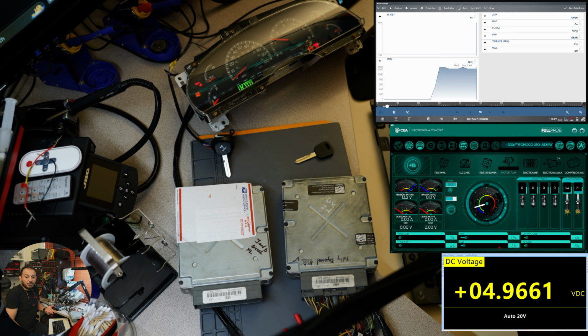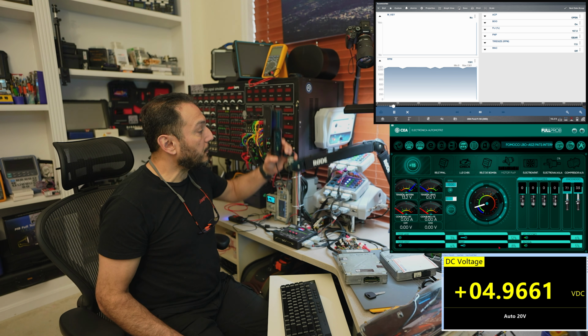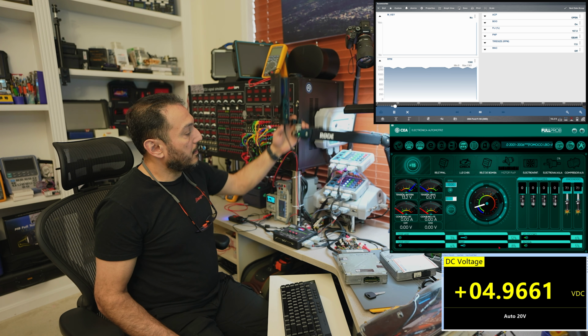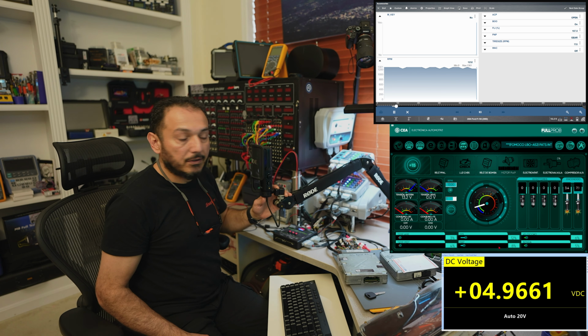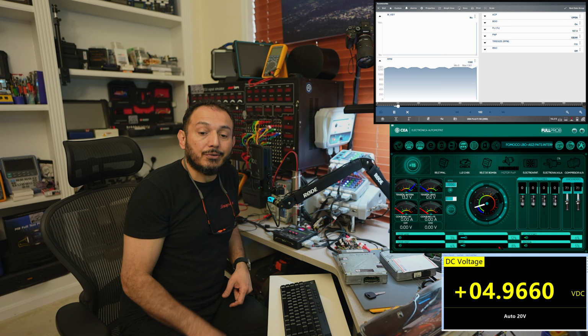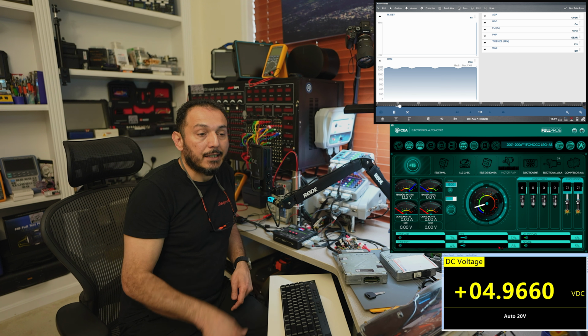And what I did now with this new setup is I also connected the signals from the coils to the probe. Now you can see two spark plugs on the screen being fired. You see that is actually nice. I like that from this tool, because if I move this capture, you can see if I move my microphone, the lights of those coils being fired. So the coils are firing, no injectors. And on the screen right now, in the green area, that's the probe. You have 4 injectors next to the coils and they're not firing.